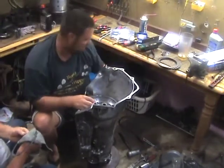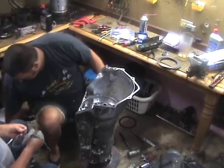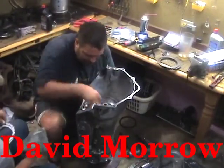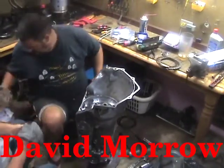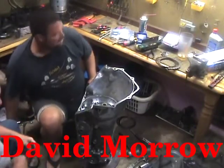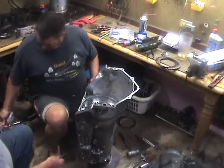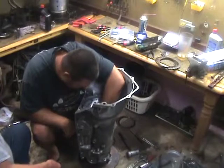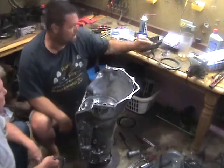As you can see, I start dropping the clutch there, and those are my old stack in the same way, and then basically I'll just take the next clutch and put that one in. Now I am lubricating them on the side there, you can't see it, but I'm going to the steel next. I'll lubricate that steel, and then after I lubricate that steel, I stick it in. Now you notice I already put it on the floor, so that's how it goes. I should have probably sped this up a little bit, but you get the gist of it. It's not basically rocket science.